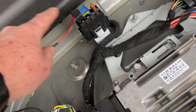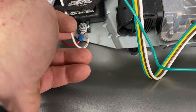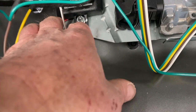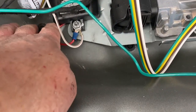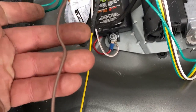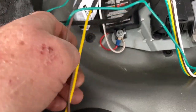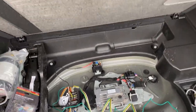Let's recap: black is power - drawing from this ignition-on fuse, so it only works with the ignition on. White is regular ground, comes with a little ring terminal. Red, which is supposed to be brakes, gets a ring terminal and is also grounded. Everything else by color is normal: brown is tail lights, green is right turn, yellow is left turn. It all works perfectly - I've checked it, no light warnings on the dash, nothing.